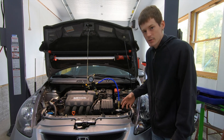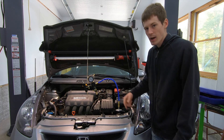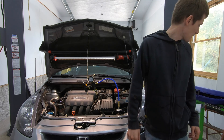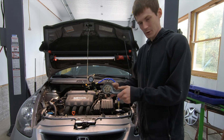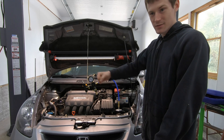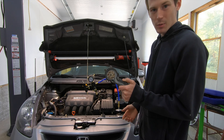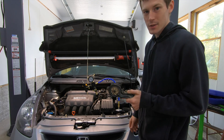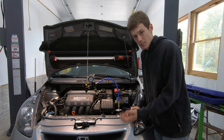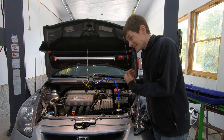The other thing is if the radiator cap is below the top of the cylinder head, you can get an air pocket inside the engine. If you get an air pocket inside the engine, the coolant doesn't circulate and the car overheats. Water pumps really aren't pumps - think of them more like a spoon in a pot, just stirring. They don't pump air well, so if you get a pocket of air in the water pump, nothing is going to circulate and the car is going to overheat.